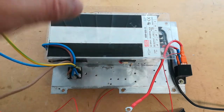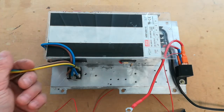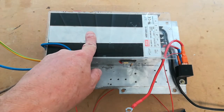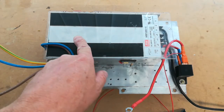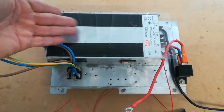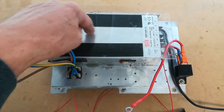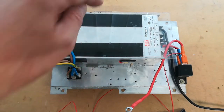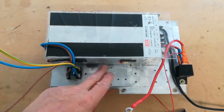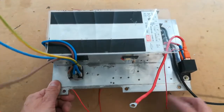It's mounted on an aluminium heatsink from the Honda Insight seen in the earlier video, but you don't have to do that. You could mount the power supply straight onto the wall of the IMA space in the back. Alternatively, bolt the rectifier to the top cover of the power supply with heat transfer compound. The power supply has a fan, so you'd take the cover off with four screws, drill a hole, and mount the three-phase rectifier onto it — making it all compact, with the cooling also cooling the rectifier.